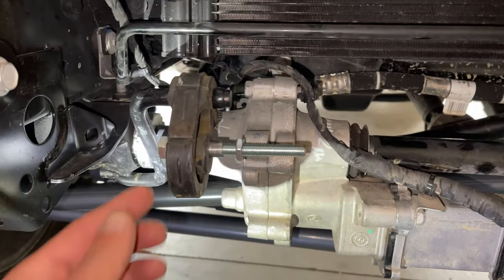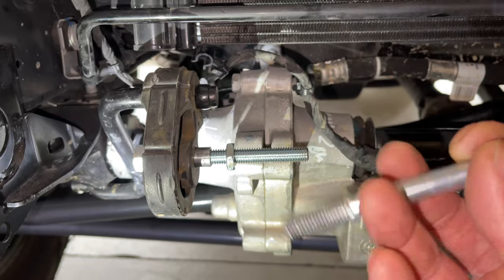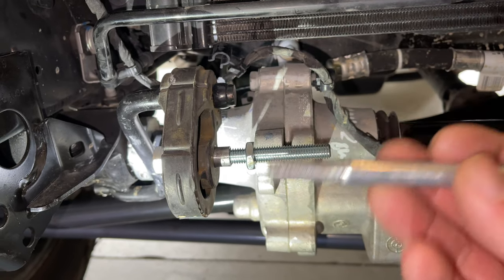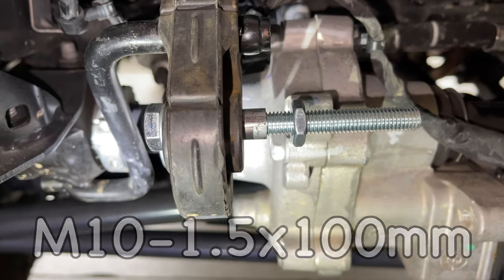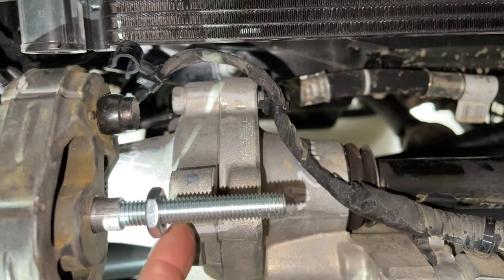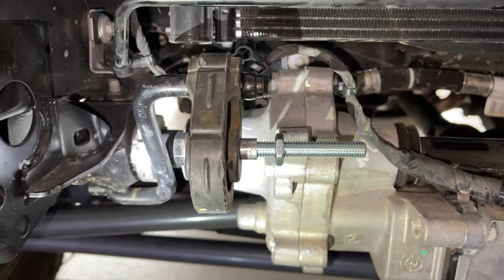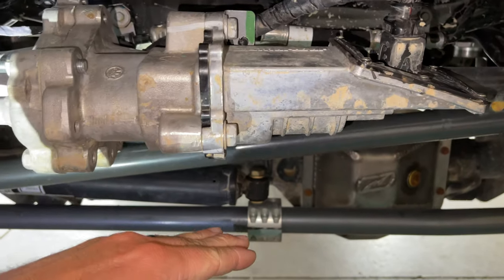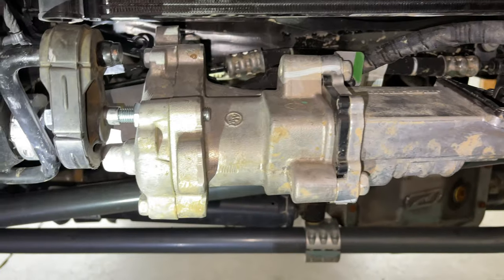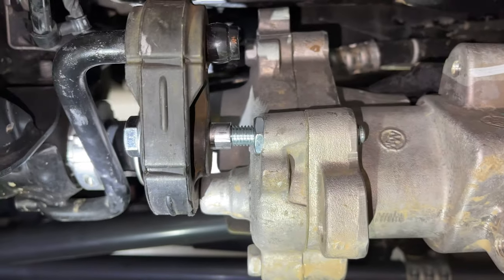Round two on the flip kit — we had to get a different bolt. The original shouldered bolt didn't have enough threads at the end; we needed about another quarter to half inch of threads. So we got a fully threaded M10 x 1.50 x 100mm bolt, which lets us set the depth and get it further up into the module so the two clamshells come together securely. You save quite a few inches having this flipped — before it was hanging down. Just bolt it in, add a jam nut and sleeve, and it's fully secure.